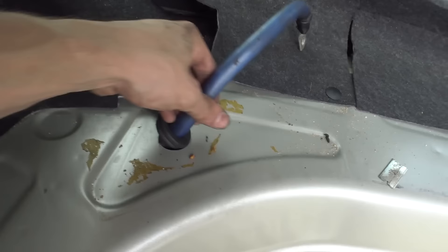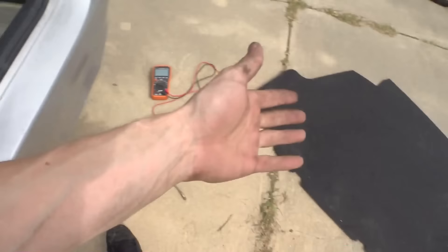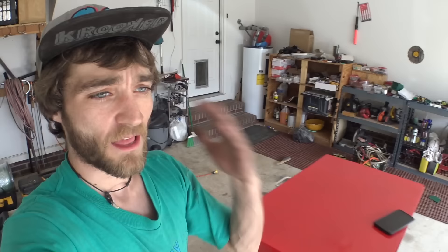Our 250-pound zip ties are holding up our zero gauge all the way to the front, nice and neatly tucked away, and it is above the lowest point of the car — so if you hit a bump, there's not going to be any sparks flying. The opening to our trunk is right here, so I'm going to tuck my zero gauge nice and safely through the wire. I need to poke a hole in the grommet on the other side — I'm just going to poke this wire through the grommet so it will be nice and sealed from the weather. That takes care of the main power wire going to supply voltage to our amplifier up back. Next up is the ground wire for the amplifier.